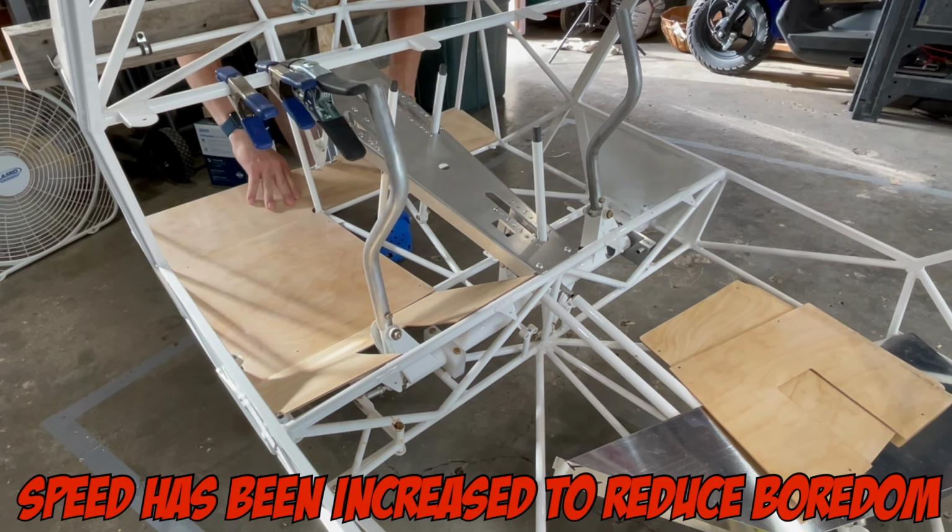That's helpful. Hitting 10. Still at 10. All right, there's 12, 13, 14. So 12 to 15, that's 14 inch pounds. That's good. Let's go to the other side. Got two over there.